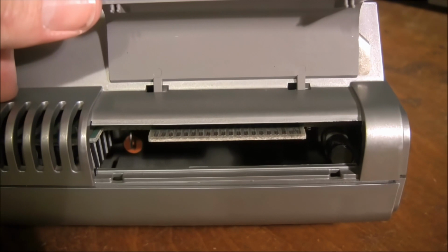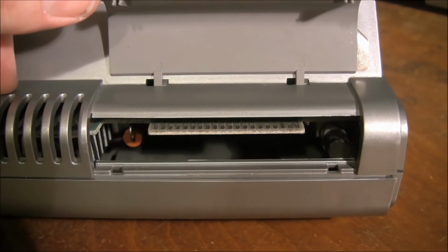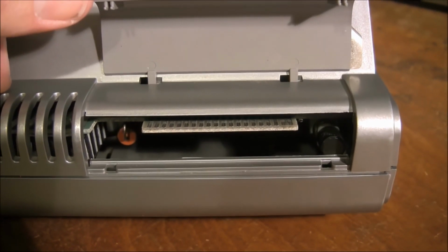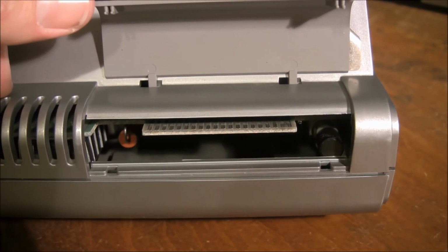Now the expansion unit held some of the RAM, as well as of course the disk controller and printer lines. So it had address lines and data lines running through this card edge, and the smallest amount of oxidation would interrupt that flow and cause what is known as a spontaneous reboot, where suddenly the computer would reboot itself.